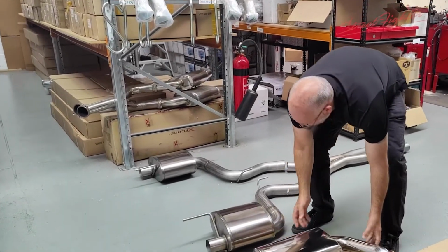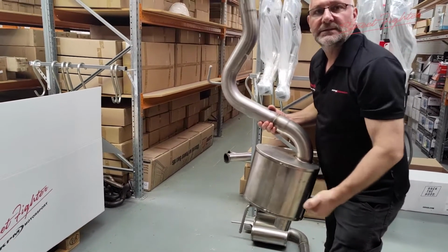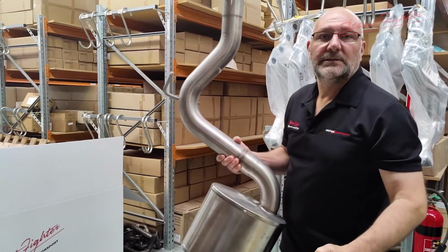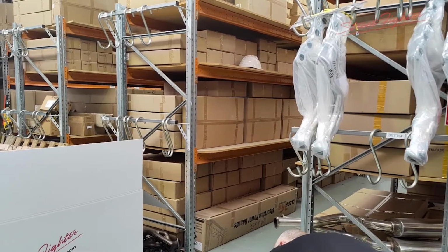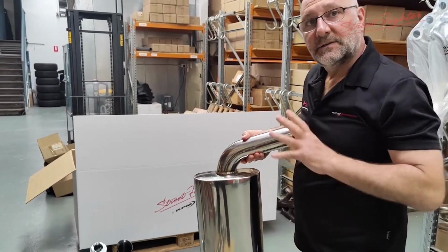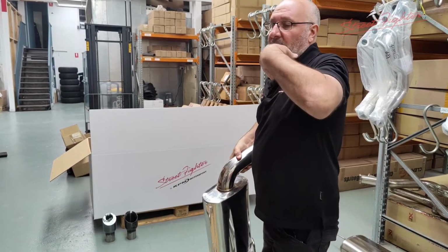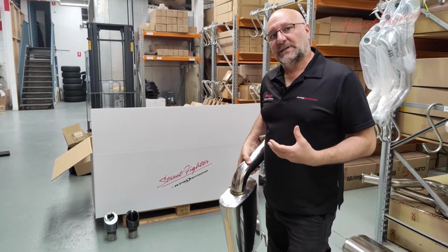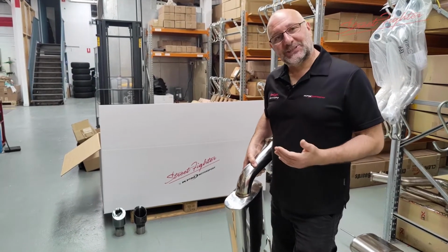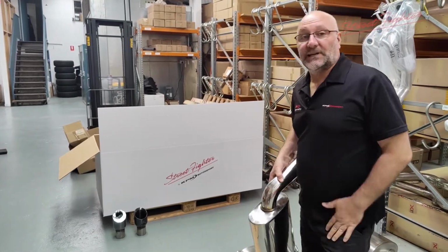So I'll just lift a competitor's, this is an overseas exhaust system. I'll just let you hear the packing. Now you can hear that's very shallow on packing, but that's purposefully done. That's to give a distinct note. Versus what we like to offer our customers is more of a fully packed, still straight through 3-inch. That gives you more of a deep V8, V8 supercar style of note. I can't explain it any other way. If you stand behind the vehicle, it's more of a pushing into your gut style of note rather than a gurgle. And that's a distinct difference between a lot of American systems and Australian systems.